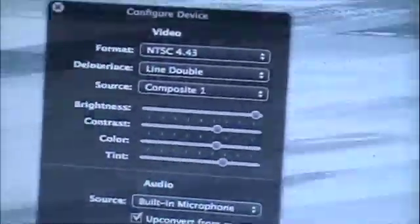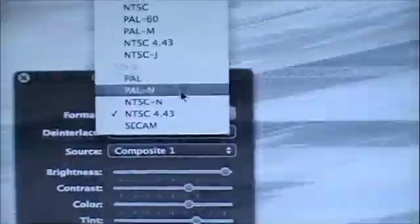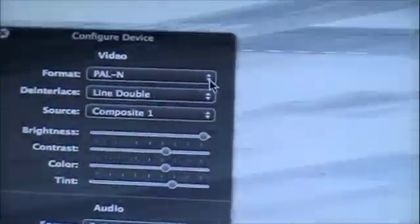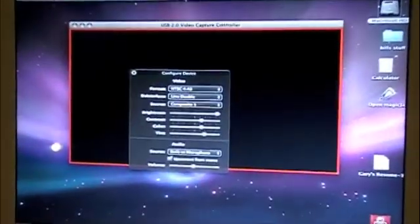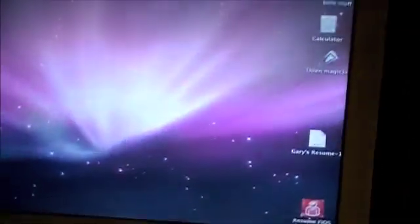EasyCap Viewer — Configure Device. That's the setting it came with — that's default. I just plugged the damn thing in. I can try every one of these on the 50 hertz and I get that screen. I know you're supposed to use NTSC — I'm in the states. And if I go to a 60 hertz connection, I get this — blank, nothing. And that's pretty much the story. I've got Flash Media Encoder, I have all the audio stuff so I can get the audio. I have CamTwist. I have all that. But I can't get the video to the computer.